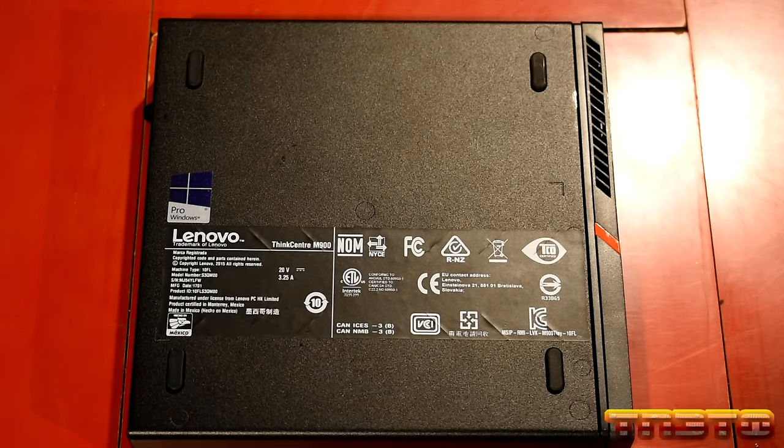Okay, so there is an unknown device. So what I'm going to do with that is, it says there's no driver installed. So when you have a situation like this, you're going to look in Device Manager for any that have an asterisk in a yellow symbol. Okay, that means, hey, there's a problem with that device. It doesn't have its driver, something like that.